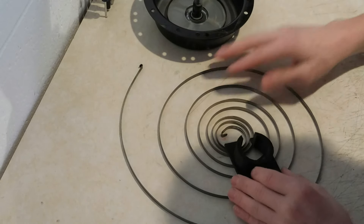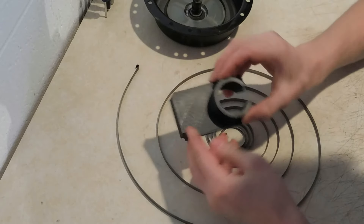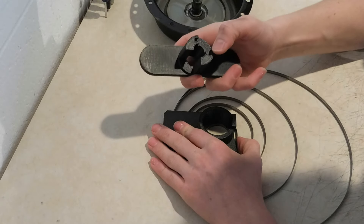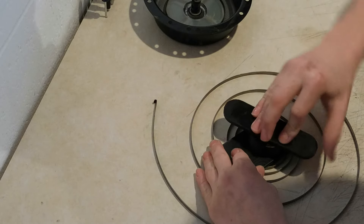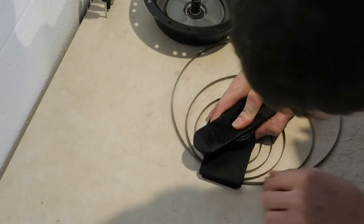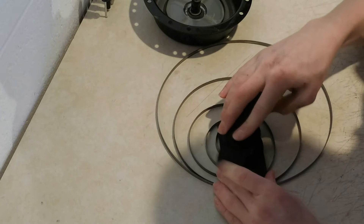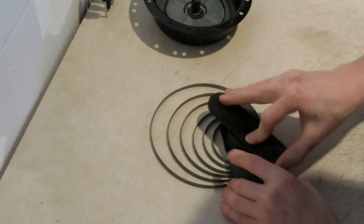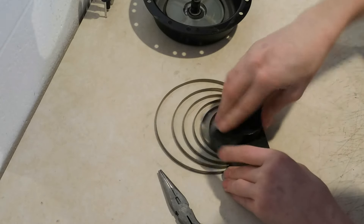We're going to have to wind it like this and coil it up. This tool has a little bit of a lip at each end, and depending which way you have to wind it, that hooks onto the outside of the coil like so. Then you can press it into the center — on there there's two lips and two little hooks, and one of those gets hooked onto the center. Line it up, there we go. Hook it on, and then you can just feed this through here and hook it onto the outside of your housing. Make sure that's hooked because you don't want it unwinding on you, and then just begin to wind it all up. Don't put too much tension on it, because the outside of the spring will wind up as you tighten it. Also, have a needle nose pliers or a needle nose vise grip ready — just keep on winding.